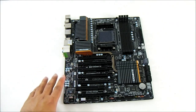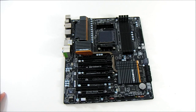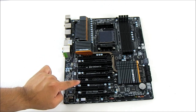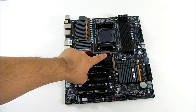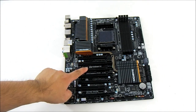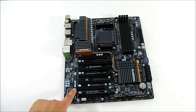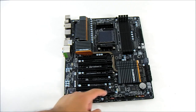This board has 4-way SLI support. There are 1, 2, 3, 4, 5, and 6 PCIe X16 connectors. Physically they are X16 in size, although not all are X16 electrically. Two are X16 electrically — for 2-way SLI, connect to those two, easily identified by their locking mechanisms. The middle three PCIe slots use push-down button locks and are 4X, 8X, and 4X respectively, with another 8X at the bottom. The middle one is actually a legacy PCIe connector without an open end.